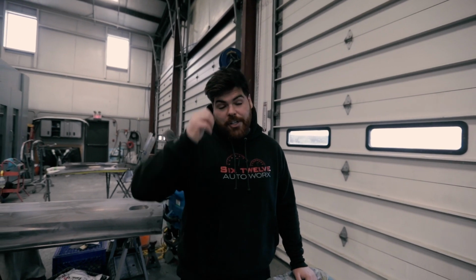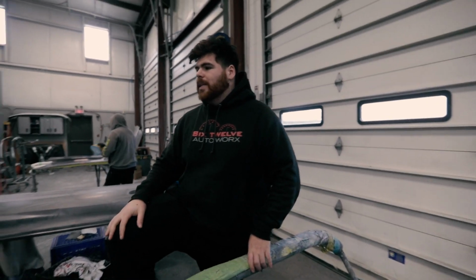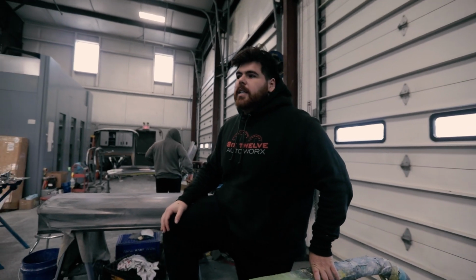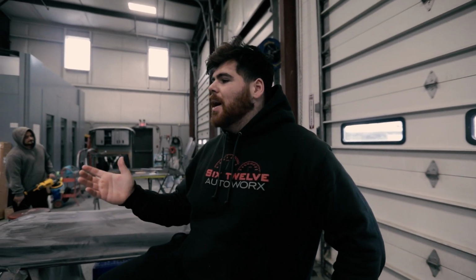Technically, it's the resonator because the car has a mid muffler and then the resonator where the mufflers go. Long story. But if we were to do that on this car, you would see it from the side and it would look really fugly. So what we do is we slightly lift the floor pan, raise it slightly, and then we take the exhaust up the center so that way when you look at the car from the side, you don't see a big old exhaust. Now, in the process of doing that, we do delete those two resonators because they wouldn't fit.